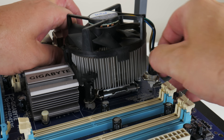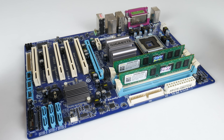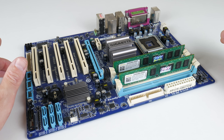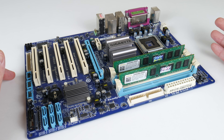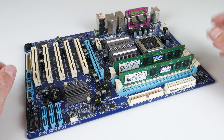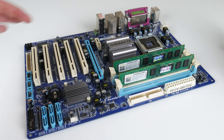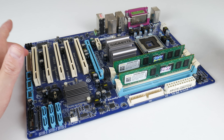To make sure the video card can show what it can do, we're going with the LGA 775 platform. We've got a mainboard from GIGABYTE, the P43T-ES3G, which is compatible with DDR3. We're using two 2GB modules for 4GB configured in dual channel. It's a nice mainboard with 16x and 1x PCI Express slots as well as five PCI slots.